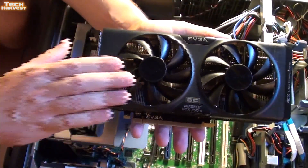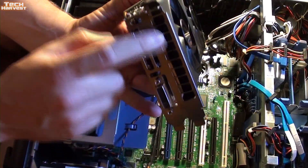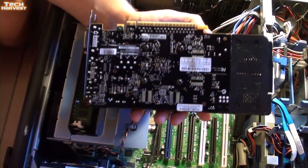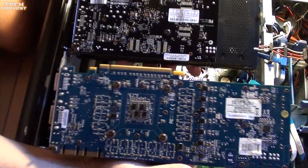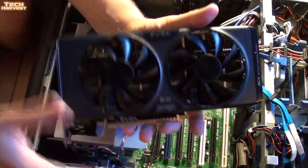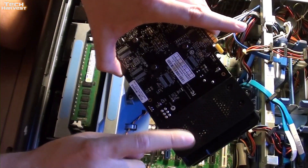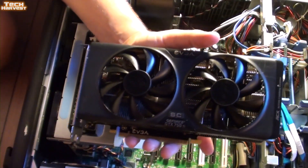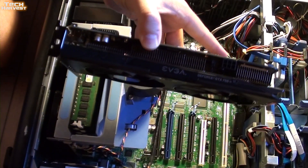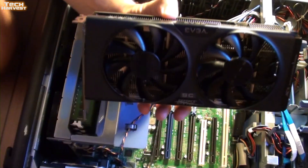Here is the EVGA SC GeForce GTX 750 Ti. The GTX 580 is actually a bigger card, but it's older and more power-hungry, and it cannot support three monitors. The cooler on the 580 is enclosed — you have an intake fan here and it blows out the back. The 750 Ti is a different card; it's more open to the inside of the computer, though it does have a vent out the back. The PCB is much smaller and more modern. Most of it is a heat sink — the heat sink even over-extends the PCB — so it should run much cooler. The power input on this is only one 6-pin, compared to the 6-pin and 8-pin on the 580, making it much more power-efficient.